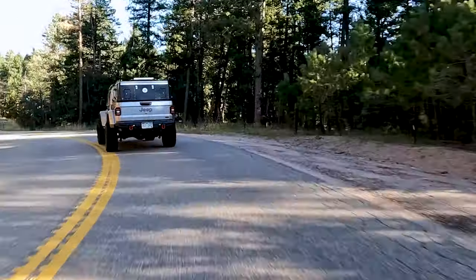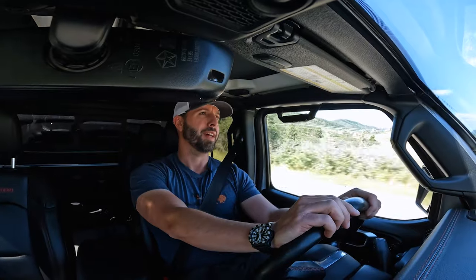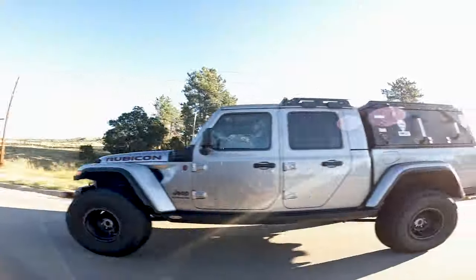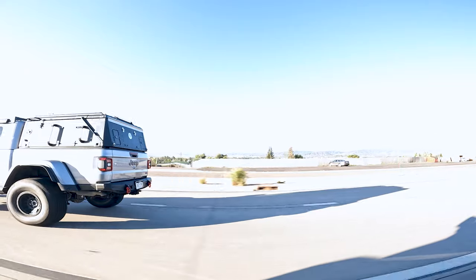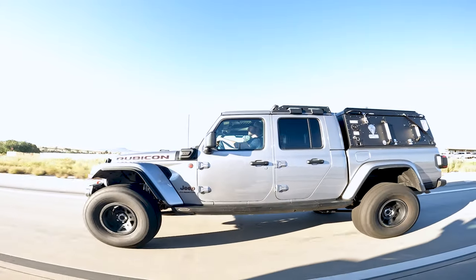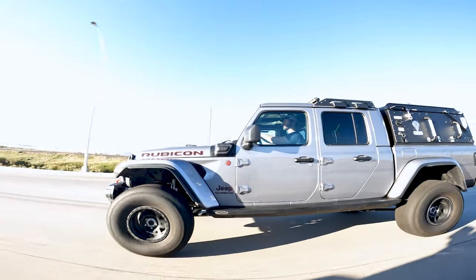Everything feels pretty well going down the road. I wouldn't hesitate taking this thing on a Utah Traverse trip or on our yearly run to Baja. Driving fatigue is nothing obscene — everything feels right. The only thing we didn't talk about in the video was axle upgrades: we did do those on this rig. It's got 5.13 gears, the rear axles have been strengthened, and the front axles have RCVs. The only other addition we're in communication with the client about is increasing the braking capability — nothing feels too out of place on the brakes right now, but when you're upgrading everything, it's probably worth checking that box too.